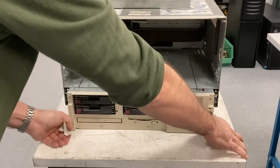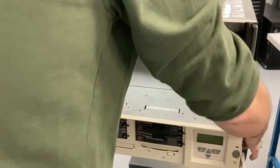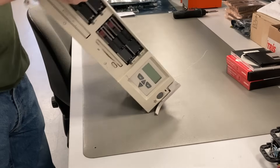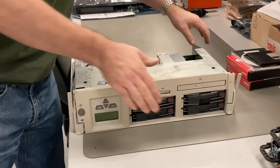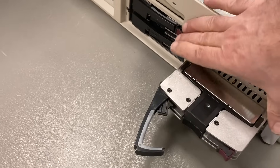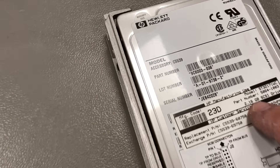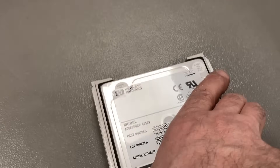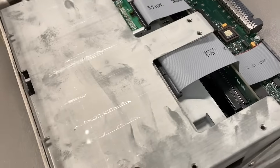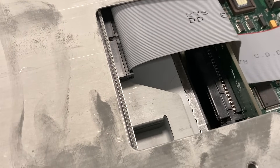The drawer under the CPU contains all the hard drives, CD-ROM drive, and floppy drive. It needs a little bit of room — it doesn't work when the server stands on a table, so I had to slide it forward slightly. Everything visible is on the underside, so you have to turn it upside down. It's a SCSI drive with 2.1 gigabytes, and it has a SCSI 80-pin SCA — a Single Connector Architecture connector. All the SCSI drives have a power plug and a data plug, and they are not really meant for hot swap, but this connector system can be removed during operation.